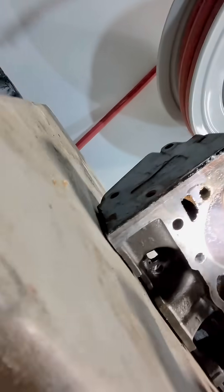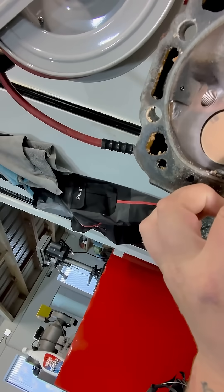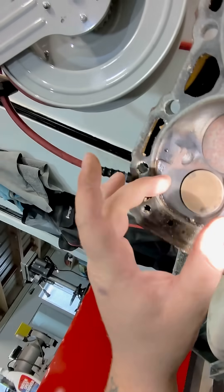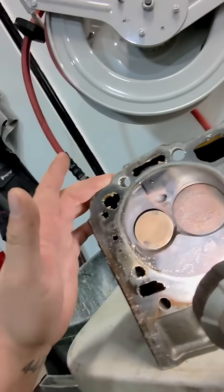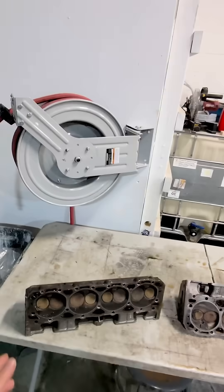It's really hard to see, but you can see this valve is lifted here. It's making contact on the side — that's what a tulip valve looks like. It's lifting here and here, and in the center it's holding pressure. Something must have gotten hot or caused this to happen, but that is what it looked like.